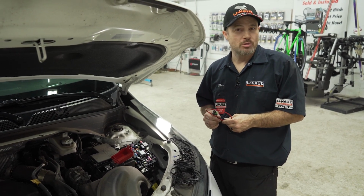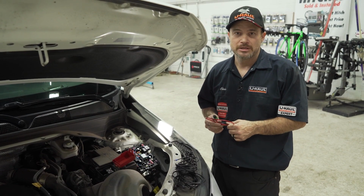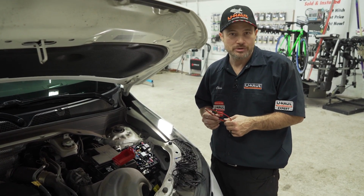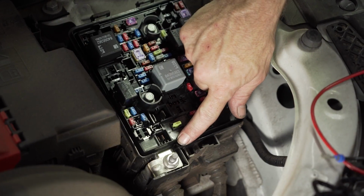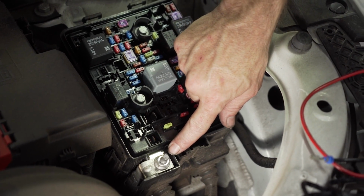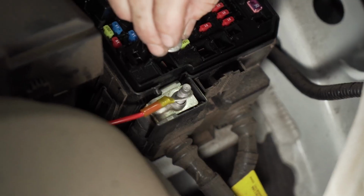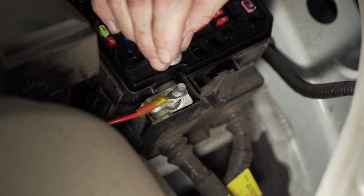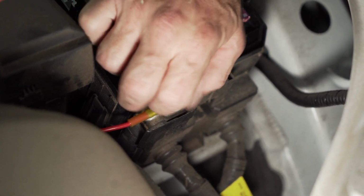We're going to go ahead and use the U-Haul exclusive OEM style pre-braided Power Wire 1. If you do not have one of these, you can pick one up at your nearest local U-Haul, or you can order one from the link in the description below. We will get power from this bolt. You can remove the nut using a 14mm socket. Place on the ring terminal of your fuse holder and reaffix the nut. Tighten snugly, but do not over-tighten.